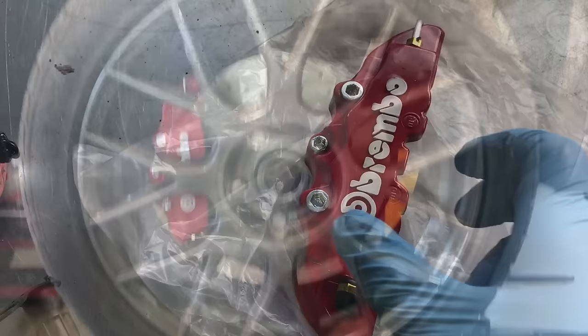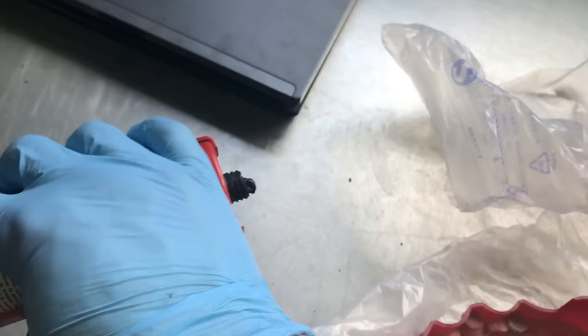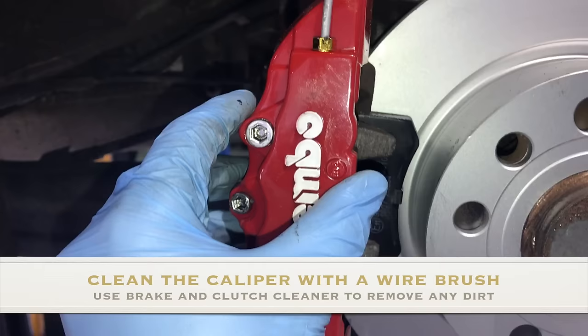On to the rears — they're a little bit more difficult than the fronts. You will have to use quite a bit of Tiger Seal to keep them on. But remember you can still take the calipers off to change the brake pads at a later date. The first thing you need to do is just make sure you put a nice amount of Tiger Seal on both of the ends, on the caliper and on the caliper cover as well.